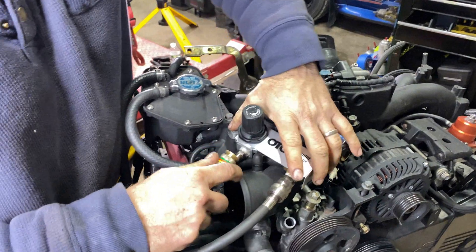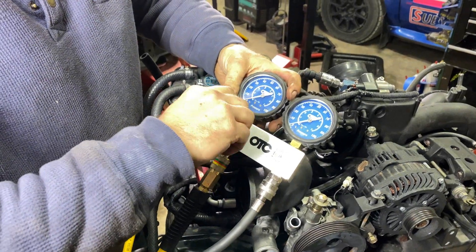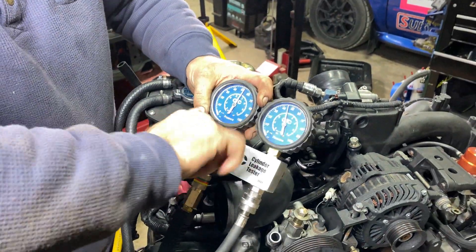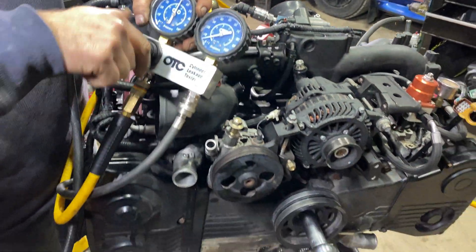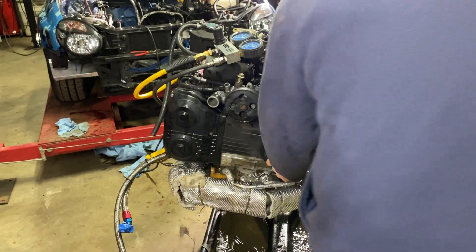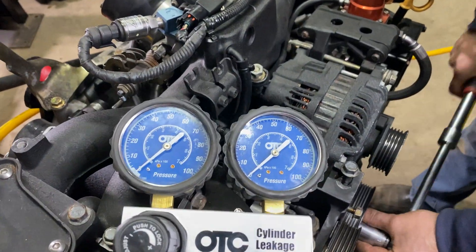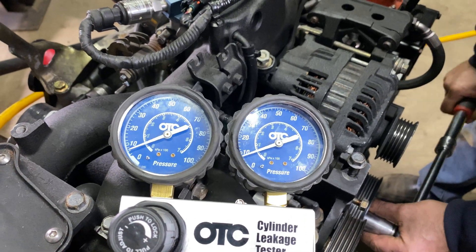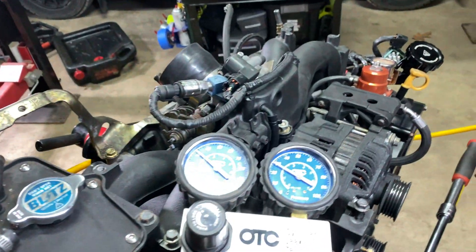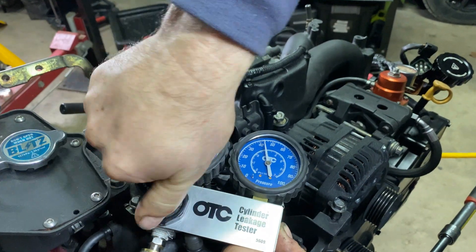Connect that — make sure this valve is closed first. Compressor is on. Here you see I'm putting pressure in the hose, we are at 20 PSI. I go up — I wasn't at exactly top dead center, that pushed the piston and the crankshaft rotated. I'm going to release the pressure and start again. I probably just went past top dead center, so it can be pretty sensitive. Be careful to not stay close to your ratchet — you saw when the piston moved the first time it can slap you, so make sure you get enough clearance.